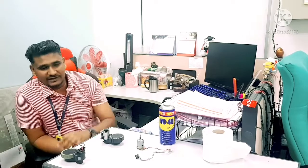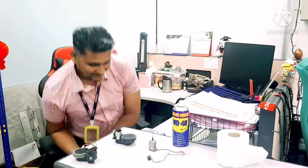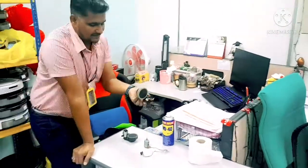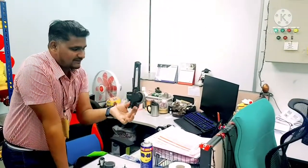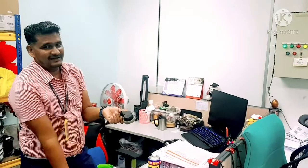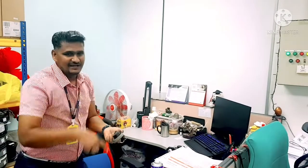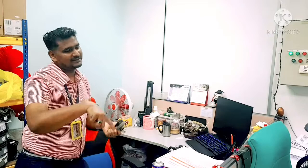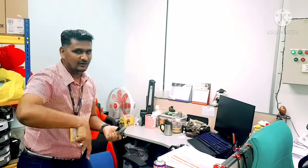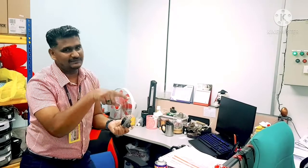If it's over warranty and you are living quite far from the service centers, you can do these mechanical and technical works at home, no problem. This wheel here is from a customer who has been using their unit for over one year. The customer said the Deebot is just turning in circles. If it's turning in circles, it means one side wheel is not functioning — if working anti-clockwise, the left side is not functioning; if clockwise, the right side.